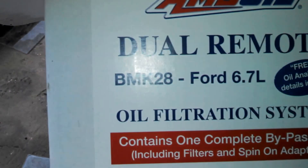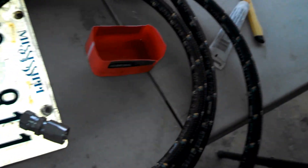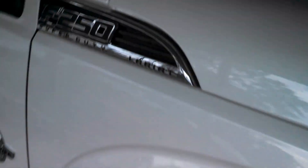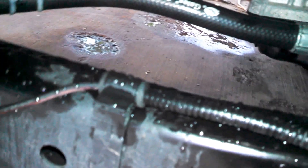I installed this on my truck, but I had hoses made because I didn't like the stock hose — there's no steel in it, you can cut it with a pocket knife. So I had hydraulic hoses made that have the same diameter on the inside as the Amsoil hoses. It's 5/8th, and you don't have to worry about blowing them out.